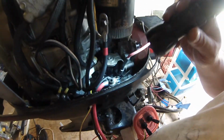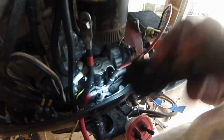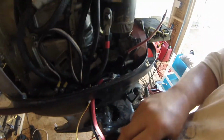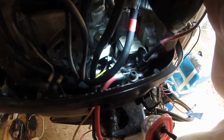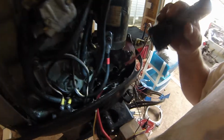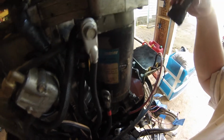And essentially what happens is the red is connected, my switch box is connected to here. The red, then the 12 volt, when I hit the switch, fires and goes down the yellow cable, hits that side of the solenoid, and because they're grounded between the two terminals, which is a coil, you'll hear it mechanically pop, allows the high voltage or higher amperage to go through the solenoid. It hits this wire and it comes up and it hits my starter, and then this is the negative side of the battery, which now becomes chassis ground. So I can check that too with an ohm meter and make sure I'm getting chassis ground everywhere. But I'll wait until I get the top on and get this back on here.